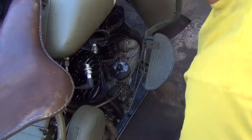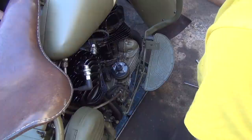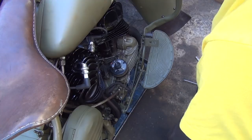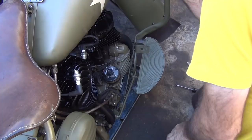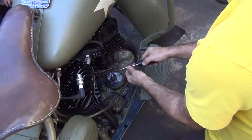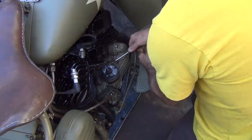Okay, try it again. Here comes, center, forward. Right there, where's it at? It's halfway between the center and the forward hole. So I moved it a quarter inch? Yeah, it's not looking bad. A couple more degrees and you'll be dead center. A couple more degrees, you'll be before it. Yeah, but I don't want to. You're moving it in the right direction.